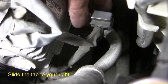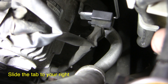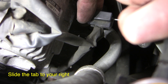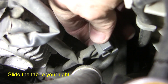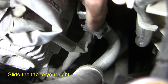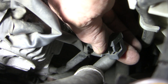This last ground connection is a little bit tricky. You get this little L-shaped pick and you lift a little tab up — lift it this way and at the same time pull it out. Lift up that tab and then pull. There's that tab there, and it fits into this little hole in the bracket. If you can't get it, the bracket is bolted on as an alternate way of doing it, but we got it here without breaking it.